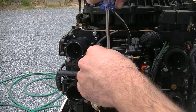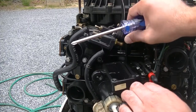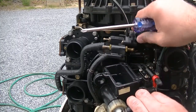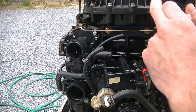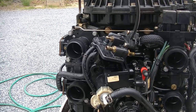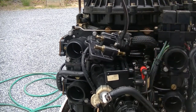So now this cap will separate, and this gasket does not look like it's bad. I'm thinking we have an issue with our seal here — I'm thinking this might be warped. But we're going to pull it out and check it with a straight edge. So let's pull it all the rest of the way out and get it in the garage.